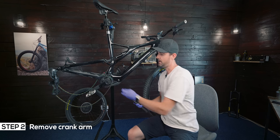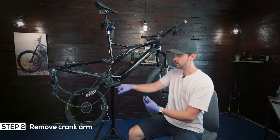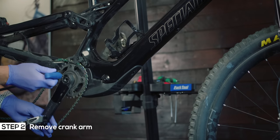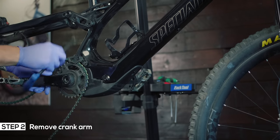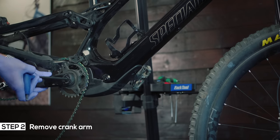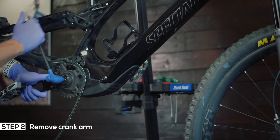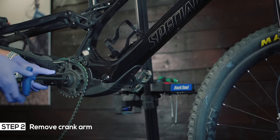You don't need to take that all the way out — that is just going to help us extract the crank. When you loosen the main bolt inside, the bolt pushes against the crank and just prizes it off. I've pre-loosened this already because they are super tight. And when we're turning that around, what that's doing is it's pulling the crank off.